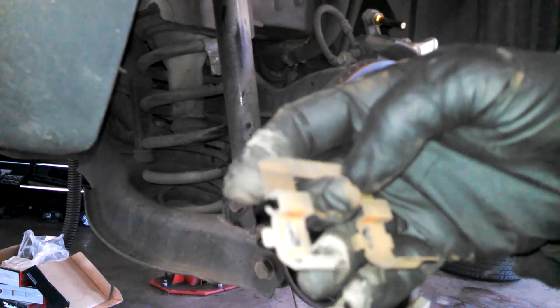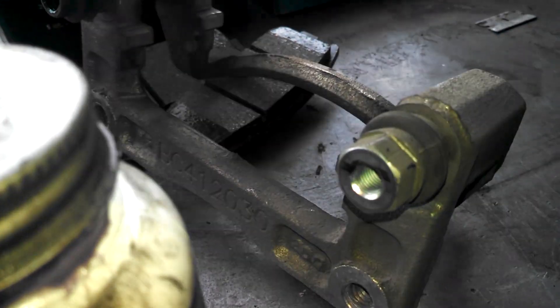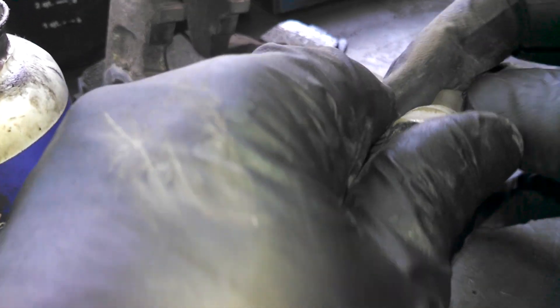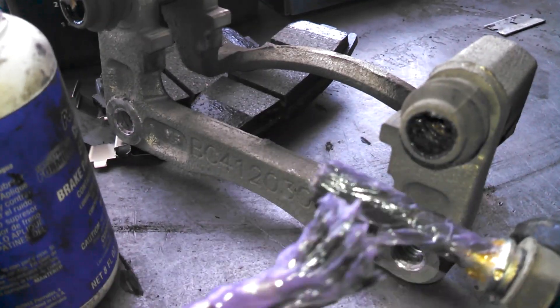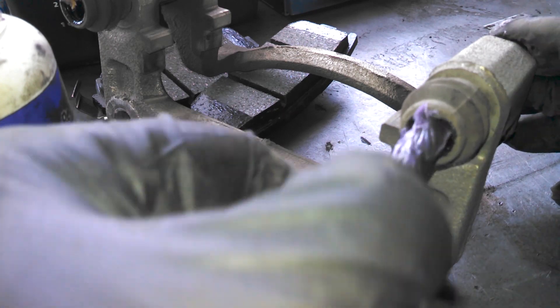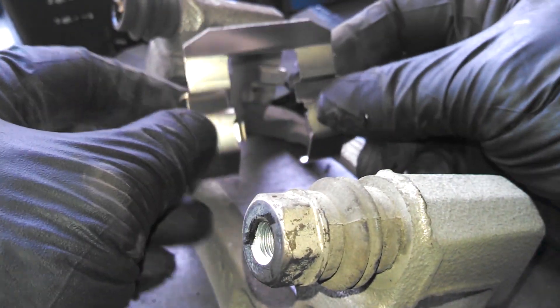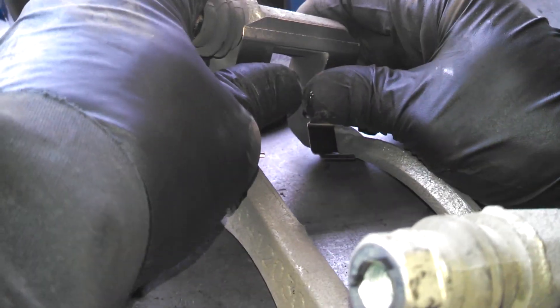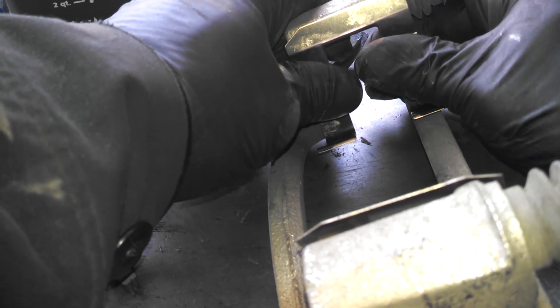Clean the slide pins or replace them with some soap and water, a rag, and some brake clean. Add a little extra lube — we'll put the purple lube on the other post as well that's still on the vehicle, just like that.